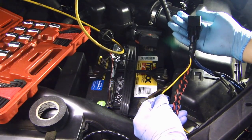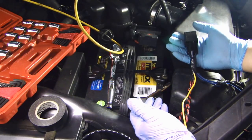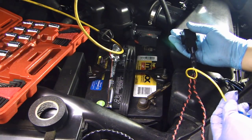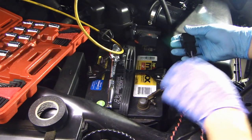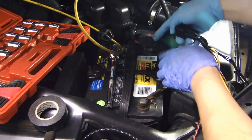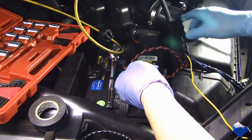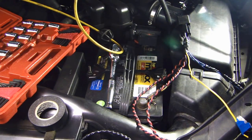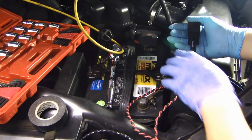So this is the relay kit that I put together. It's pretty straightforward. It uses a 30 amp 12 volt relay — a single pole double throw, or SPDT. From this relay you have a trigger wire. This yellow wire will be connected to the fog light 12 volt, so whenever the fog light turns on it will send 12 volts to this relay, energize it, and complete a circuit. I have blue wires coming out for the 12 volt, which is fused and going to the battery. I also have ground going to the chassis. The red and black wires are the output going to the HID ballast — that's why I have this connector here. And that's all you need for a relay kit. You can buy these off eBay pre-made, but if you know how relays function, you can build your own.